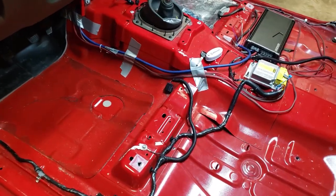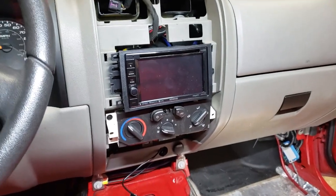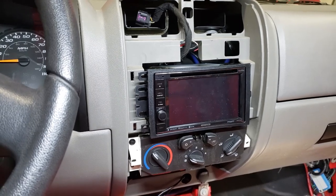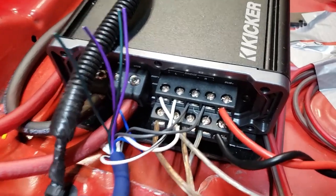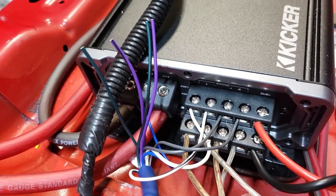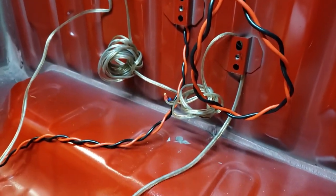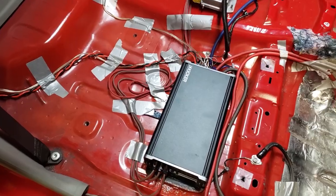I've made a little bit of progress. I put the head unit back in temporarily because I needed to test everything, and everything works. As far as the wiring of the speakers is concerned, all the front speakers — the grays and whites — are done. The red and black is the sub. I called an audible on the rear speakers because this car never had rear speakers before: instead of using the purples and greens from the speed wire, I just wired directly to the amp. I still need to get the carpet in and figure out if it's going to work or if it's going to be an epic fail.